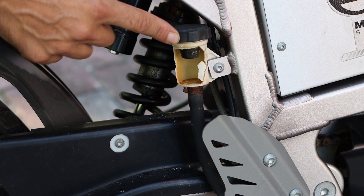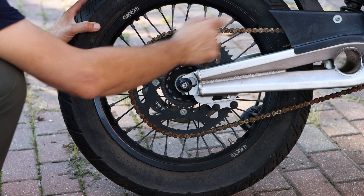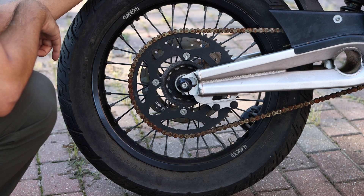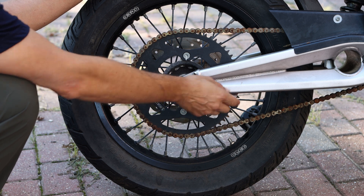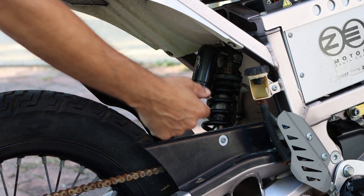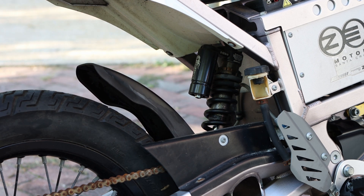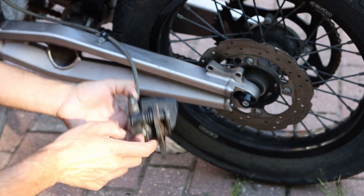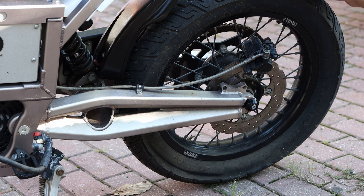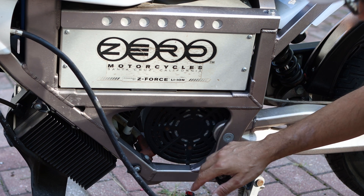We're going to need a new rear master cylinder. There's one giant sprocket and the chain is a bit rusty — I'm not sure if I'll reuse it. The chain on this is smaller than a 520, so I'd need to buy a new one. The swing arm is very lightweight. The monoshock is busted — in transportation it threw all the fluid onto this tiny little fender. The calipers were off and there's quite a bit of rust. It's a very odd rear tire size — 16 inch, the last time I've seen that was on an old Ninja 250.